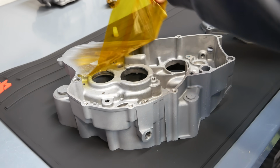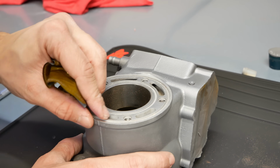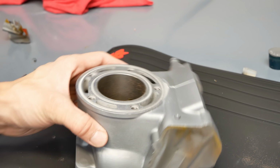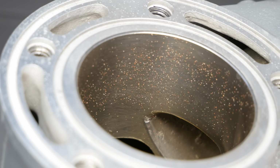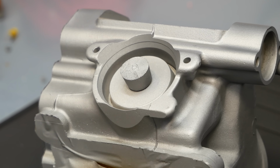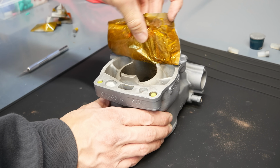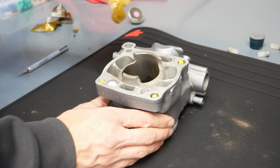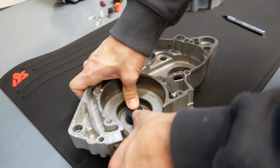Now you will see inside the cylinder quite a bit of blast media got through. Sometimes small passageways form under the masking, or the tape gets blown off in one area and media gets inside of components. It has not caused any damage, but it would if not all removed. So these parts will get a thorough scrub and blasted with air to remove any leftover blast media.